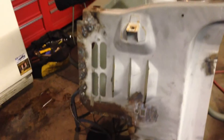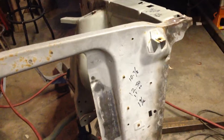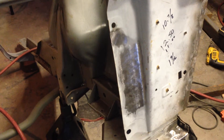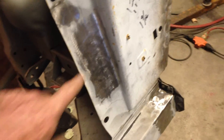The front corner here looks a little dark and rusty from the humidity out here, but we fixed the front corner and spot welded that back together again. This side's been spot welded too. There were a couple holes that somebody had drilled in there — we don't know if it was for an oil cooler or a different air conditioner — but we patched those holes up.